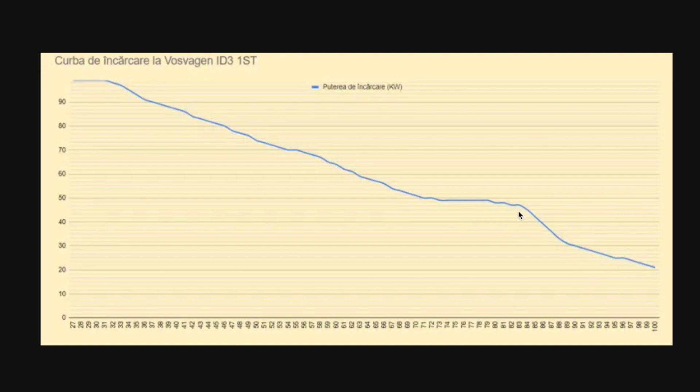You should consider charging the car up to 80%, which is what's recommended. This curve is much quicker than expected, but they did say the ID.3 First charges at 100 kilowatts, and this seems to be the case. I actually believe this curve is very, very realistic. We get our ID.3 Firsts in September, and this is what we expect to see on the Ionity chargers.